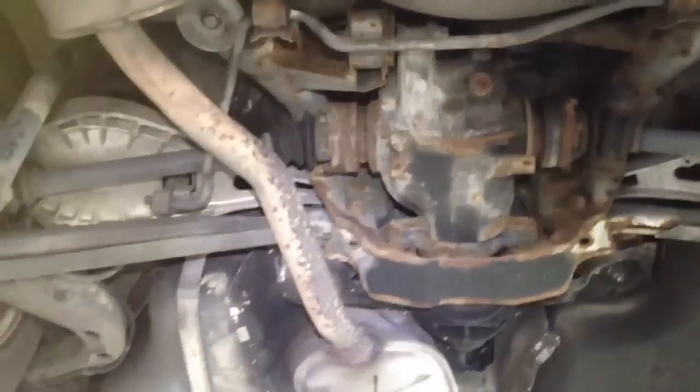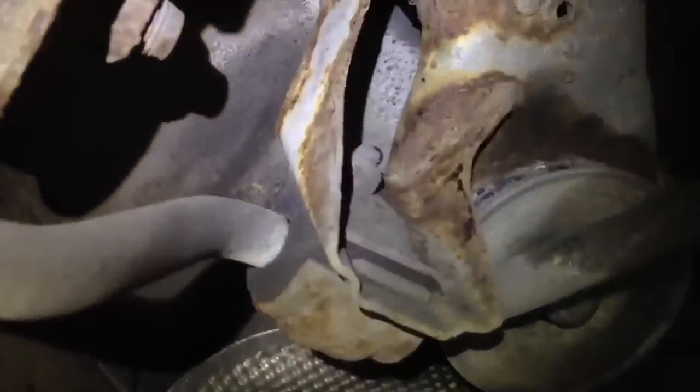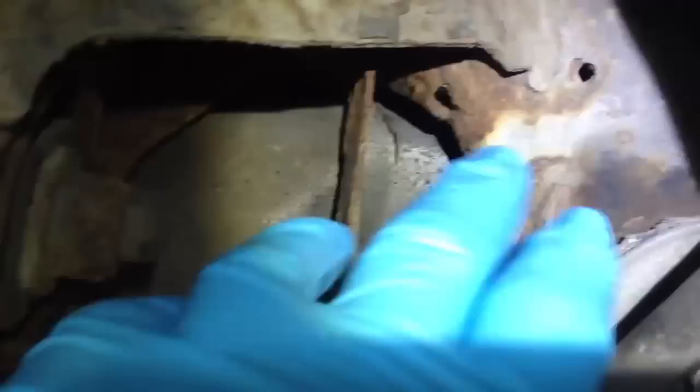Under the E46 318 now — just a 1.9 16V E46 chassis with exactly the same rear axle carrier panel as all the E46 range. We've got the typical hairline crack on the fold of the floor next to the left rear subframe mount. That's the standard one there, but this one's a 1999 model year, when the floors were slightly different, just before they changed in February 2000.